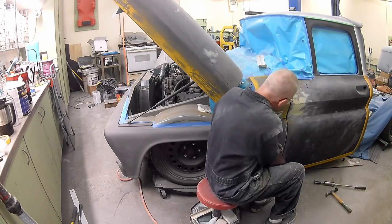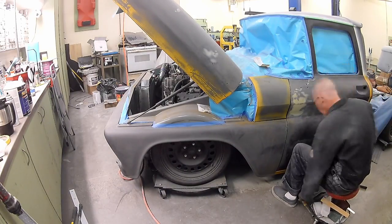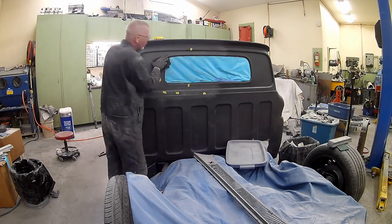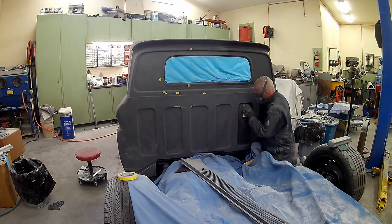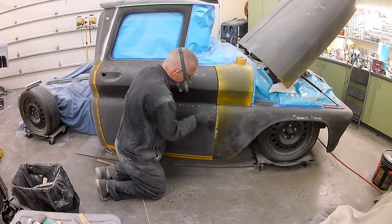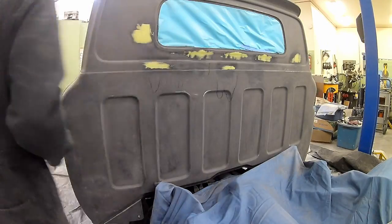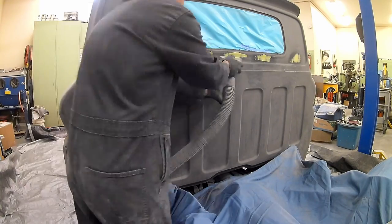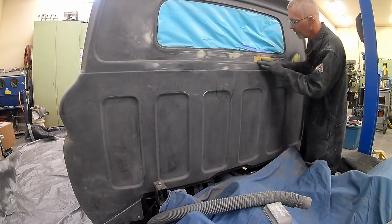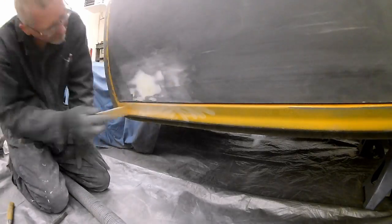You saw me with my crazy slide hammer, which you can still see on the floor — that's just pulling the fender out to try and match the doors. You can see a little bit of filler on the leading edge of the driver's door. That is from the door stopper puller openator holder backinator thing that had broken with the previous owner, and the door opened so far, kissed the cowl panel, and the fender creased it pretty dramatically. So I'm trying to make that nice. On the back here, we've got little pieces of masking tape to help me find the defects. And here you can see the shiny high spots where my weld seam is — I fabricated the bottom half of these doors because issues. Using a vacuum cleaner to try to suck up the filler, but discovered that just sucked. So I stopped using it. And sanding away.